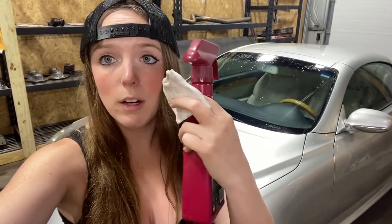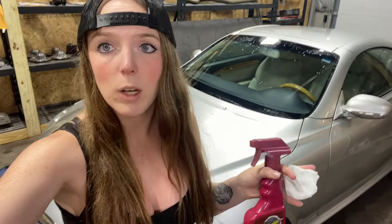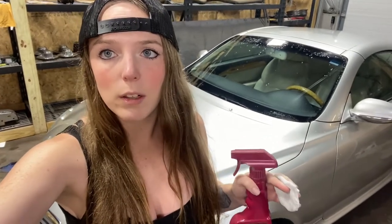This is considered a quick detail. If we were to really grind down on the car, we would obviously wet sand the entire car, but I will not be doing that — I'm going to just do spots. To start, I have my Meguiar's quick wax and my clay bar, and I'm literally spraying some quick wax on, rubbing it all down with the clay bar, and then I'm going to move to a cutting compound.